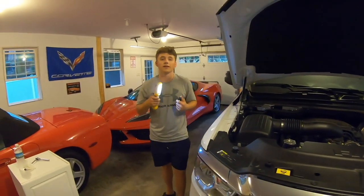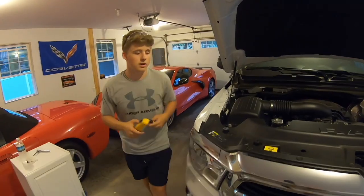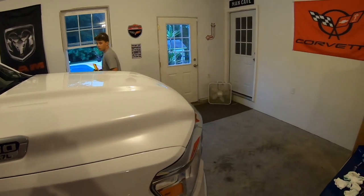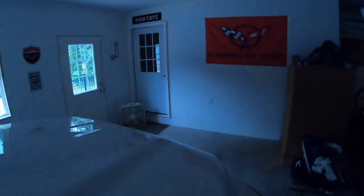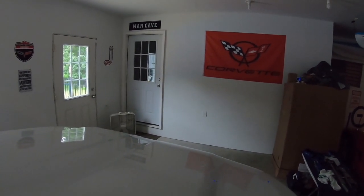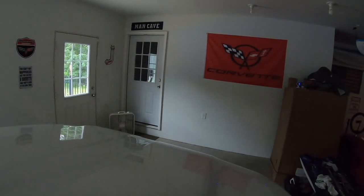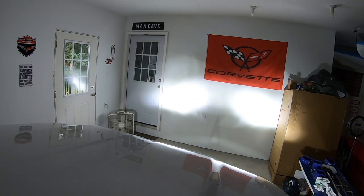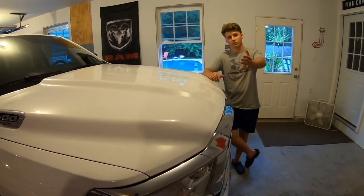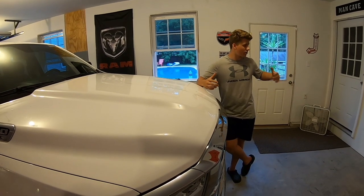That's it — that's how to install LED headlights onto your stock halogen lights. We'll give you a look right now. This is the brand new LED bulbs in our stock halogen lights — that's low beam, and this is high beam. Obviously I like this mod a lot. This is one of the best mods we've done to this truck. We just got done with both headlights. I'm going to insert a clip now of me driving later tonight so you guys can really get a feel for how bright these are — headlights against a white wall isn't really a good gauge. Overall, this project was not really difficult as long as you follow the steps. The difficult parts were just getting the bulbs in and making sure they're oriented right inside the actual headlight.